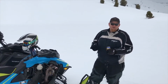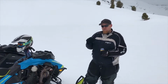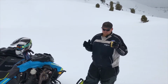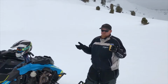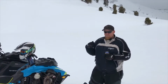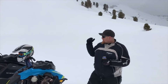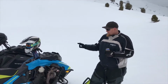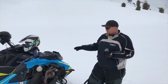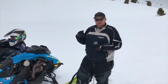It does not have the throttle response a stock sled has until you get into boost. Once you're in boost, it's right there. But from whatever it is, 1200 RPM to 3000, it's not boggy like an old sled. It'll sit there and snap, but it's not stock responsive. I did put the 2019 billet helix in, and everything's weighted correctly, but it's not snappy like a stock sled off the line.